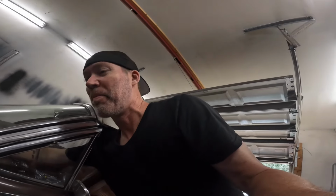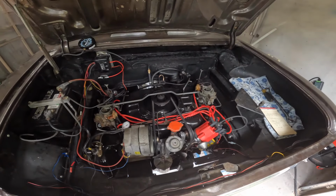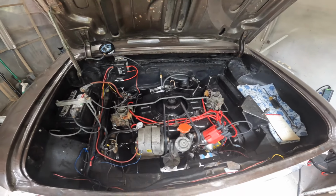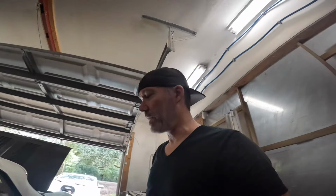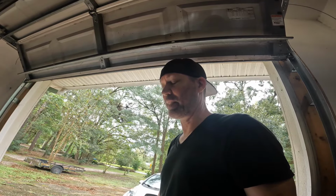It's been a little while, right? It's been probably like an hour or so. So I think it sounds better. I don't think I hear that clang anymore, but let's check it out. I think the valves are in a better spot, so I think we could cross that off the list, and I think that it definitely makes less noise. I still think there's something there, but I'm gonna put the valve covers back on, and then we'll see if that makes any difference, and go from there.